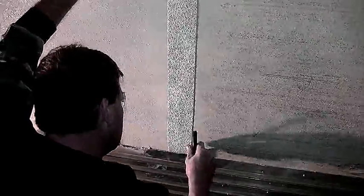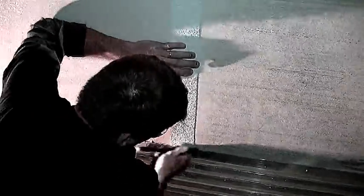After you've applied the 3-inch Quick Patch tape, make sure you use the brush to brush the wall next to the patch. This is to make sure the edge sealer will bond to the fiberglass. It's very important that you brush it very well. Also, brush along the bottom of the panel at the scuff plate. You're going to run a bead of edge sealer down that scuff plate where the new piece fits in.